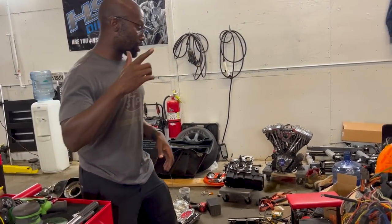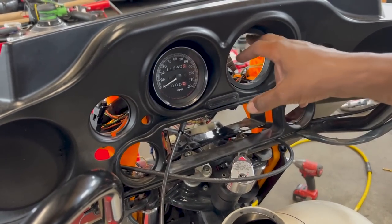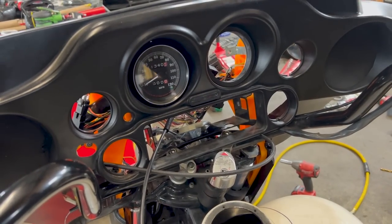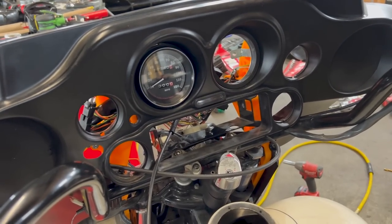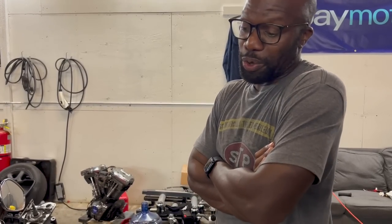And then the other thing is, we actually removed all the gauges in the cluster as well, all except for the speedometer. We have two here and two here. We're debating what we want to do for this one. I think for these four, I may have the individual voltages of each battery. And then this might be an information display. You found a really nice one with amperage as well that had the battery charge readout on it. It had how many amps you're using, watt hours, and also run time as well. So it actually could be pretty cool.